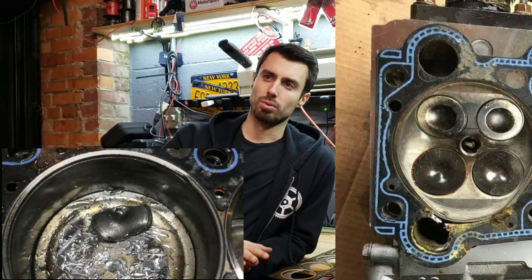The other thing with a cut ring head gasket — and Boris supplied these pictures, he drag races his E30, crazy build, really good guy — if a cut ring head gasket fails catastrophically, the ring could actually get into the cylinder. If that happens, you're going to have damaged valves, a damaged head, damaged cylinder walls, possibly damaged pistons. Now, chances are you'll never have that failure, but I always like having a fuse, and I think you have a better fuse with the O-ring block versus the cut ring head gasket.